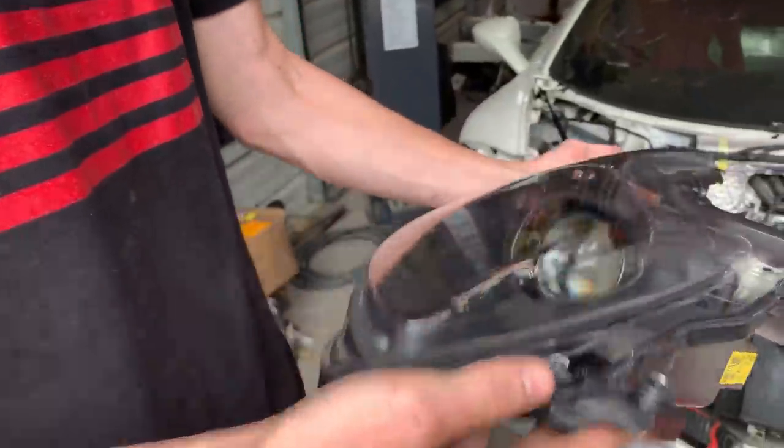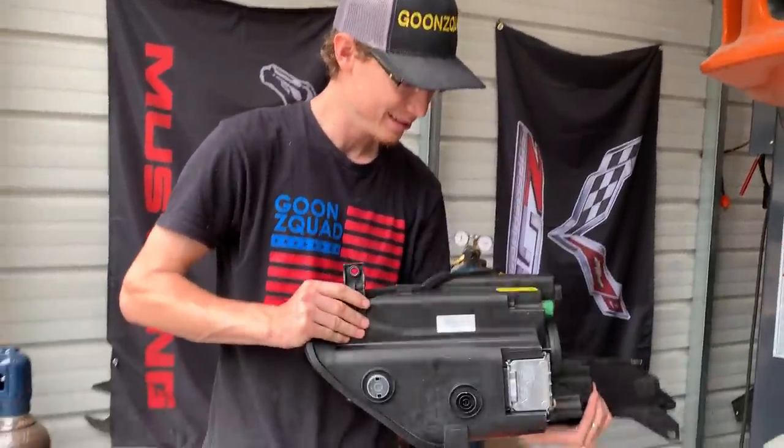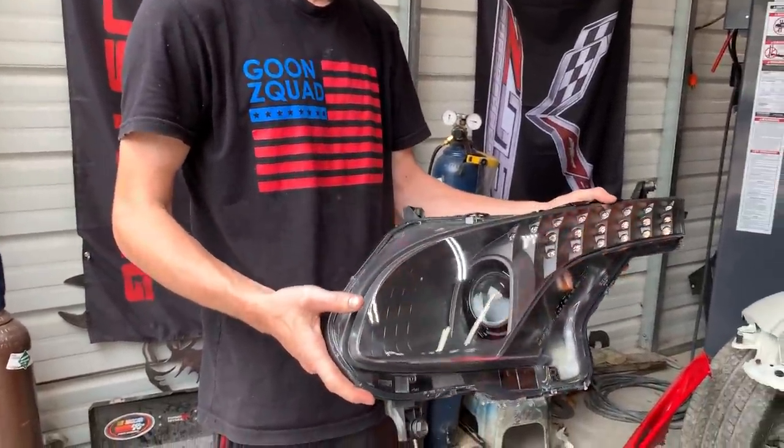It is, sure is, dude. That looks good. Dude, if it's used, it's a freaking good used headlight. No, you can't get them, or you can get them used, but the crazy thing is you got to match up the headlight to the VIN number or you're going to have a bunch of lights go on in your dash, which you don't want any of that.